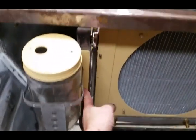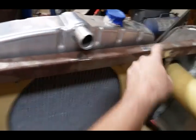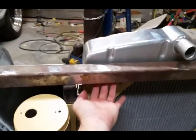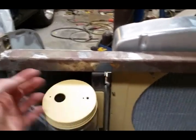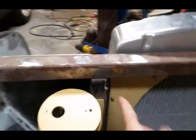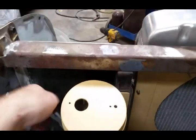Around the back, the wire for the horn is going to come out and go up in here under the car. I have welded bolts up under there that loom clamps will bolt to with nyloc nuts to hold the harness up underneath out of sight. I drilled a hole with a step bit up inside here to pass through both parts so the wiring harness goes through there and it'll be on the back side of the inner fender — completely hidden.